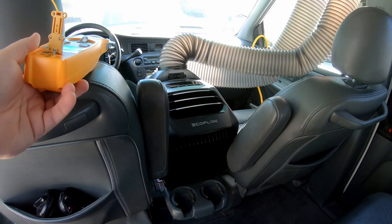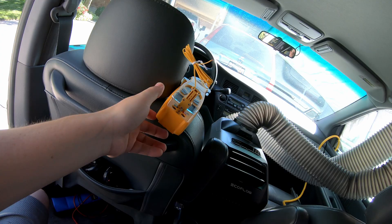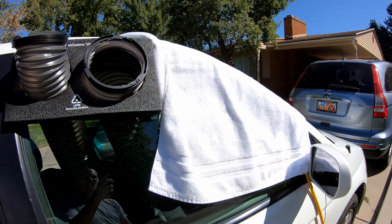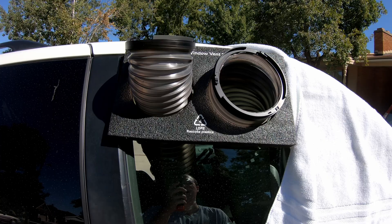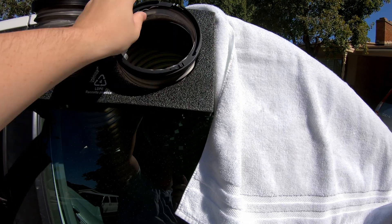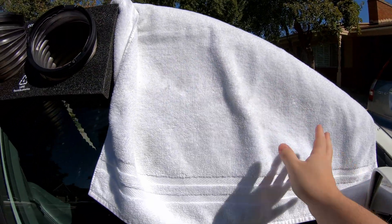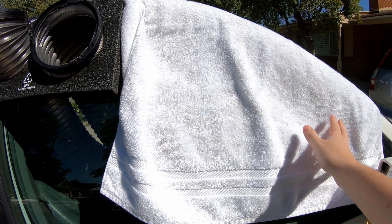A couple things to note: it's 87 degrees up here by the ceiling, the door is slightly open so I have a little breeze. We're going to close the door for the testing. The outdoor ambient air temperature is 92. This is how I've got it vented — using the window vent kit that came with the Wave, I've got the hot exhaust air going out. The intake is angled separately, so hopefully we get as much cool air pulled in as possible. The window doesn't close all the way, so I've just draped a towel to provide a little shade and block some airflow through the crack.